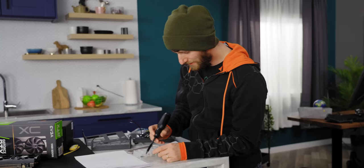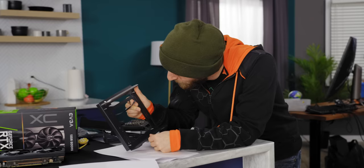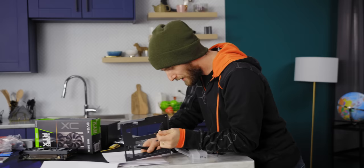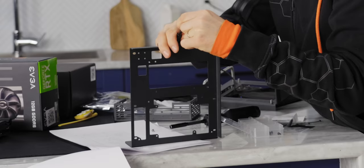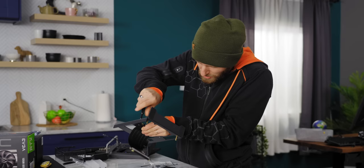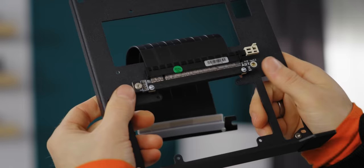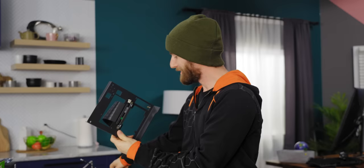Non-ferrous screws — I know it's premium, but I hate it. Install four B motherboard standoffs secured with four J screws. I think I did it right. I sure like picking up screws with my hand like a chimp. I'm a little confused by this step — they don't show where you're supposed to route the PCI Express ribbon cable for the riser. So I'm doing my best; I think it's supposed to go on like this, though. It's not clear how the whole thing goes together yet.